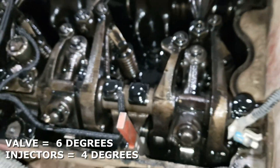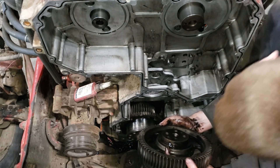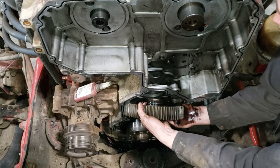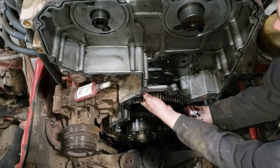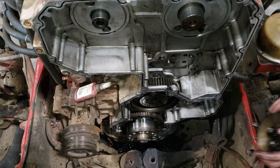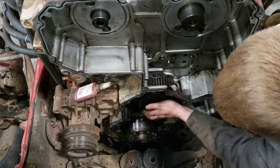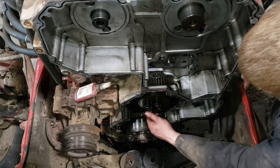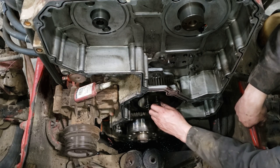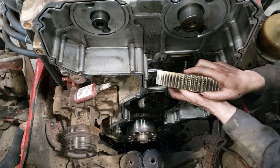Now those two cams are locked into place. We're gonna go to the front of the engine and put everything together. First thing you're gonna do is get the lower idler gear in place. Some of these idler gears or cam gears are scissor type gears and they have small bolts going sideways in them — you take a wrench and back off those bolts to line the teeth up and take the preload out of the springs. Once you get this gear in place, go ahead and slide the four bolts and the washer on top and get those all snugged up, but not perfectly tight yet.